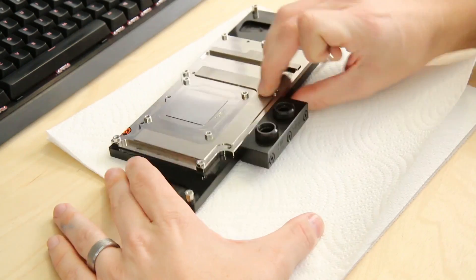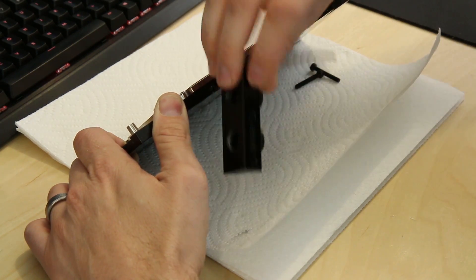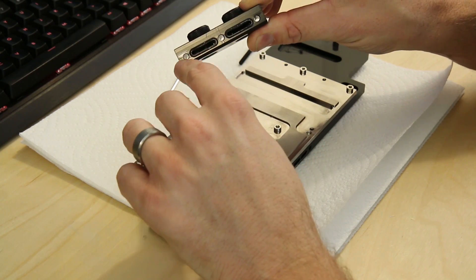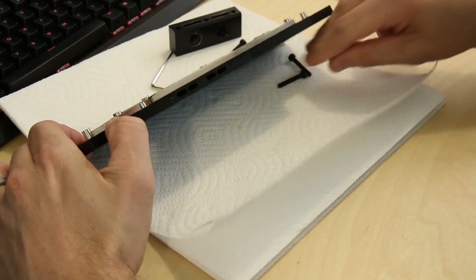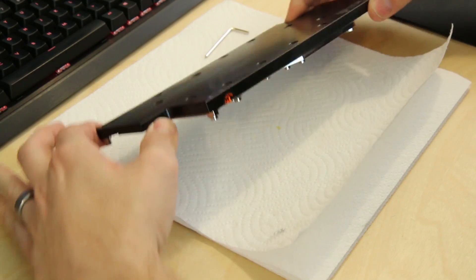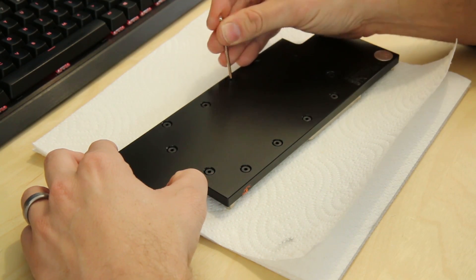I don't think there's going to actually be any buildup in here, but for the sake of this video and the fact that I changed all the blocks, I at least want to see what's going on in there. Now when you undo the third screw here, the thing might swing away. You want to be careful because right here there are two very small oval O-rings that are creating a seal against the actual block. So you definitely don't want to lose those. We have a little bit more of that white - it's almost like a powder, almost like a salt. I found a very interesting post on overclock.net about that. You don't want to lose those O-rings - be very mindful of that. Also keep in mind this is going to void your warranty. There is a warranty sticker right here between the two components. When you take it apart, it will break that, which is going to violate your warranty. So definitely something you need to do at your own risk.